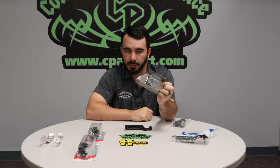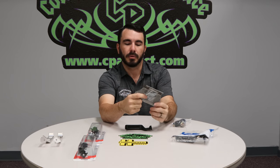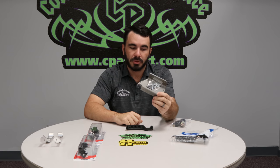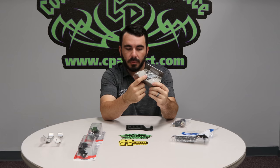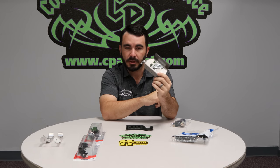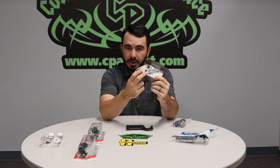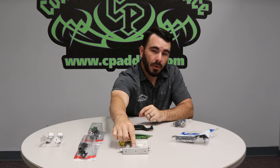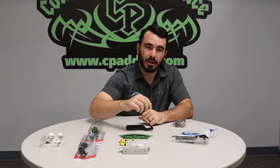It's a really simple install — the hardest part is taking the door panel off. What happens is the factory metal on the door starts to fatigue and the door gives each time you pull on the handle, causing you to yank harder and break the handle. This plate goes in place under the handle assembly — drill a couple of holes, install your rivets, bolt your handle right back down. It's a one-two-three process. This actually strengthens the door and fixes the weak point, so you don't have metal fatigue or flex in the door. This is a big key even if you don't have a broken handle issue — it'll take flex out of the door and give a better open and close.